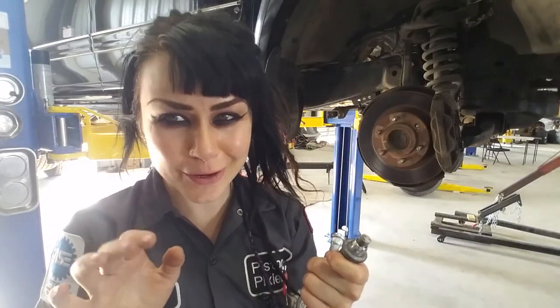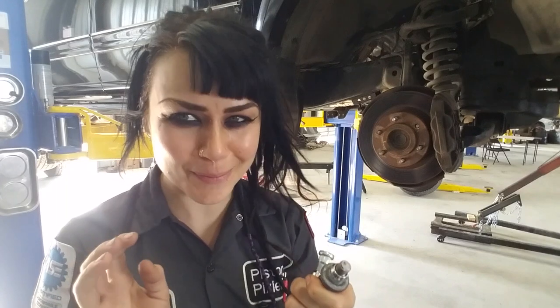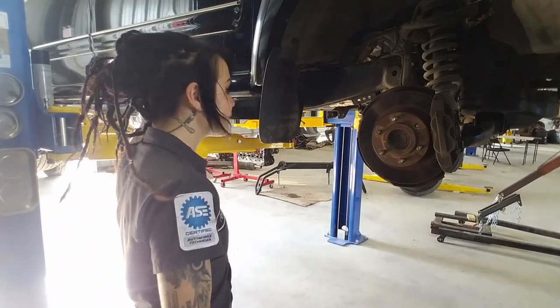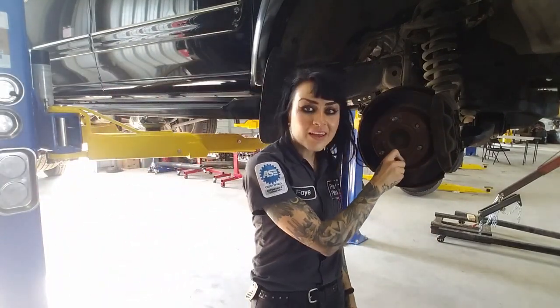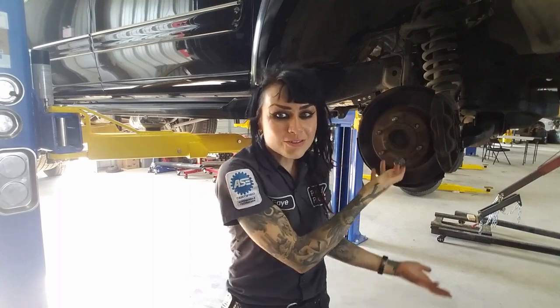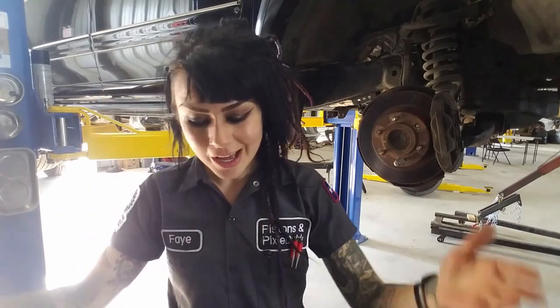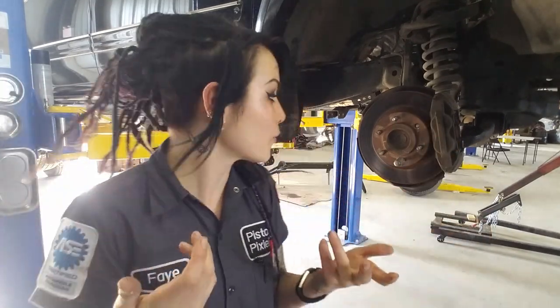It's not your fault. I remember when I used to work at the dealership and I would have a cross-threaded lug nut or something that wouldn't come off. I would look in the system, look up the last person who worked on the car, and make them replace it. Because normally - how does this happen? They get cross-threaded or they're put on too tight because someone didn't use a torque wrench, or someone didn't take the time to gently thread on the lug nut before going to town with their impact, which happens all the time and is really annoying.